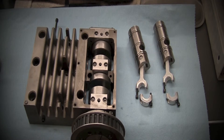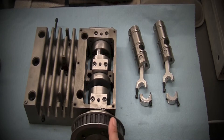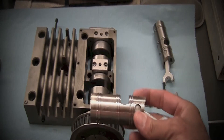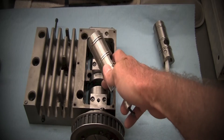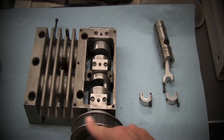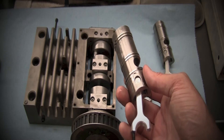With the glide valve engine technology, we only have three moving parts, and I wanted to show that. This is the main moving part, which is the crank. You can see the crank as I turn it. This is your other moving part — there's a valve, and you've got your rocker arm that connects right here to your crank and pushes the valve in and out as the crank turns. So there's only three moving parts to the whole head design. Very simple, very straightforward.